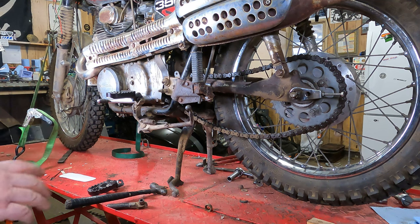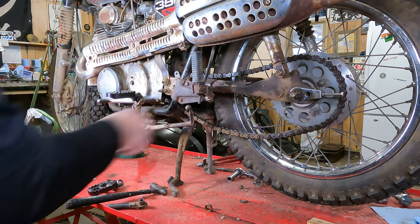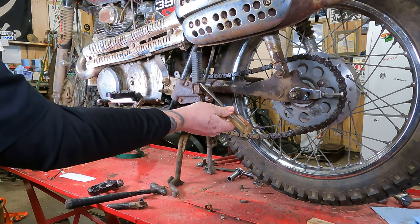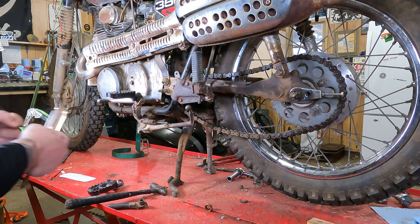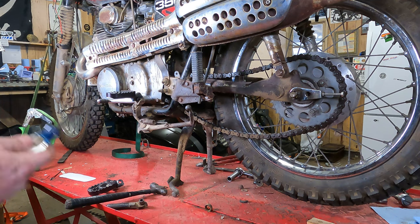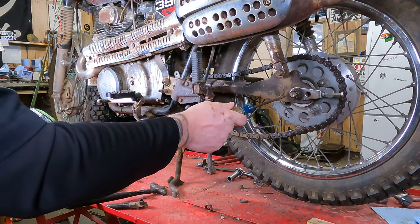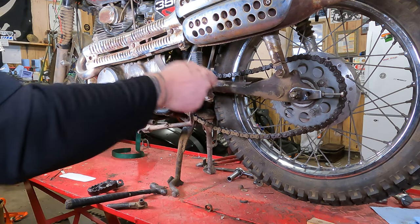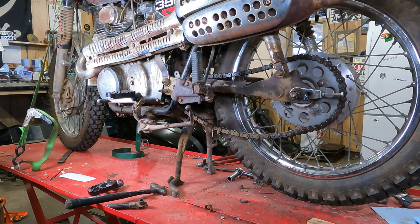That's where you want to set it, because if you set it so that even at ride height your rear swing arm is on a downward angle, then when you hit bumps and the suspension compresses, the rear suspension going up will over-tension your chain. Now this thing's set up on the stand and I'm doing this by myself. I'm going to take a ratchet strap, hook it around here and up to the grab handle, and pull it until everything's in line. Once everything's eyeballed close to being in line, I can set my chain tension.